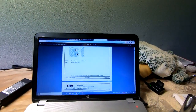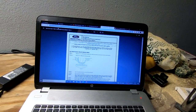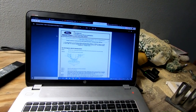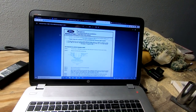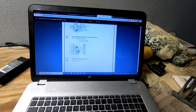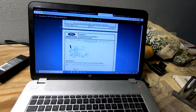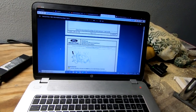Lastly, before we get going, I'm going to have this linked in the description below. Ford Racing Performance Parts, they have this little manual online. If you Google 8.8 ring and pinion install for Ford, you'll find this sheet. But again, it'll be linked below. And these are the instructions I'm going to be following just to get a good idea of what we're doing. So I have to start off with taking off the wheels and tires on the rear end. So we're going to do that first. And then we'll pretty much hop into this sheet.